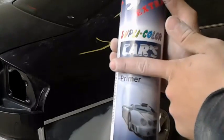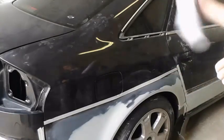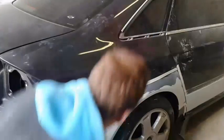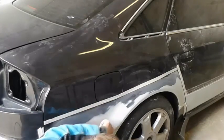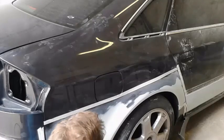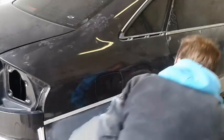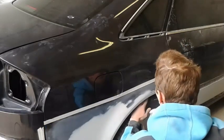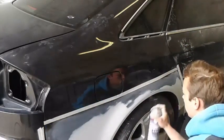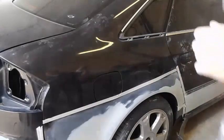Thick coats won't do any good. They may not dry. I wait about 5 minutes after each coat. After the last one, wait about 10 up to 15 minutes before you sand it. And when you do, use already used sanding paper, and make it a P600 grit. There is no need for anything more, so you don't have to use the spray can again.